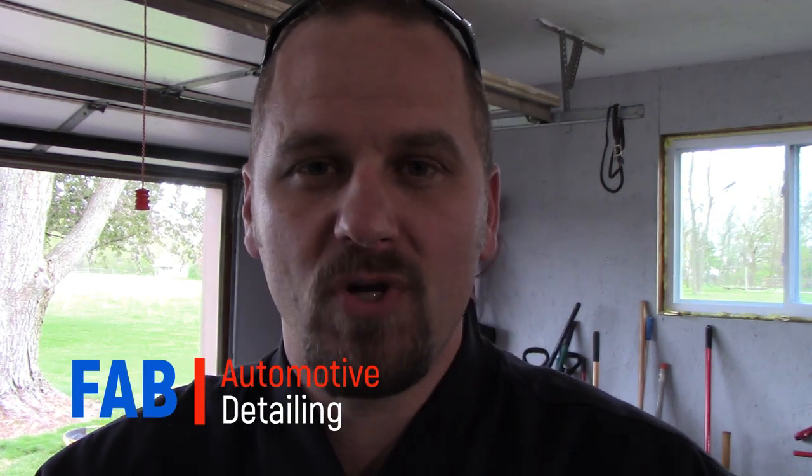We started off with surface prep by Adam's Polishes to strip off anything that may have been on the paint. Then we used the ceramic coating, and after that we used Ceramic Boost because when you get done using your ceramic coating, about 24 hours later it's going to feel a little tacky. So you hit it with a silica spray sealant like the Ceramic Boost — it really smooths the paint out and leaves a nice protection that lasts three to four months, if not longer. Then we used the ceramic acrylic black wax on the plastics, which looked absolutely fantastic. If you guys haven't tried that product yet, you have to — it works so good on plastic trim and on paint. The mower looks good, it was a cool video. I figured I'd make it for you guys to show you the new mower and what I did to it. Will the ceramic coating actually help clean the deck the next time? That's the biggest question, and I hope it does. I hope I can keep that deck looking as nice as I can and keep the mower looking as nice as I can. It was a different video — I hope you guys enjoyed it. If you did, give me a thumbs up, hit that subscribe button down below, hit that bell so the next time I upload a video you get notified. We'll see you in the next video.